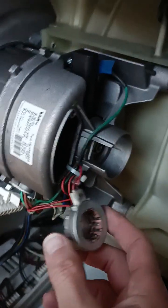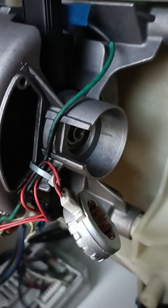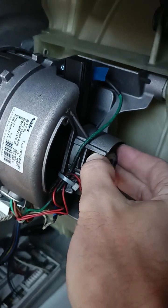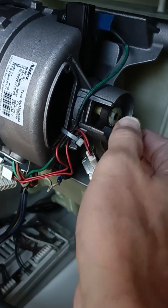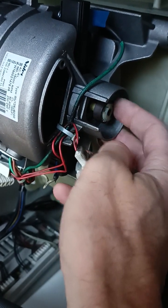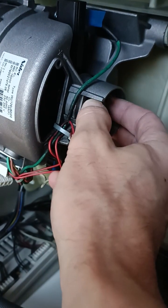So I'm wondering if this is the problem. What did I find when I prized that off? A hole — because when I prized it off, something else came off with it. Here's what came off: this thing here. It's got a magnet on the end of it and it's threaded. When I found it, it had dropped down into the bottom of the machine. I dug it out after it sprung out and then realized it's actually supposed to screw in here. So I'm going to screw it in now. It's pretty obvious that it sits inside this housing and turns, and that's how the machine is able to work out what speed it's going at. So I'm going to screw that in all the way.